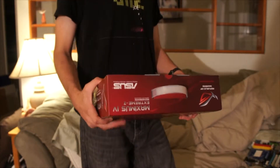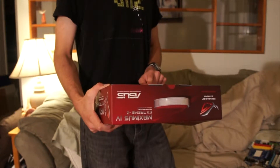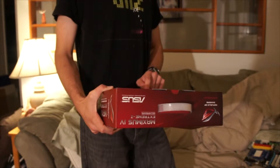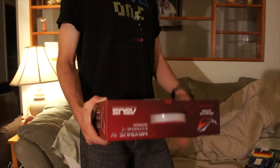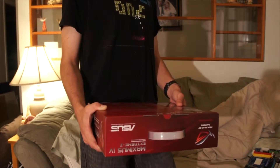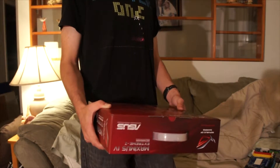Multi GPU storage: Z68 comes with two SATA 6Gbps and four 3Gbps ports. It supports Intel RAID 0, 1, 5, and 10. We also have a Marvell controller, so we have two more SATA 6Gbps, and also external SATA 3Gbps ports at the back through a JMicron 362 controller. The LAN is two Intel Gigabit LAN ports. We also have high definition audio through Realtek, Bluetooth, and USB — a whopping eight USB 3.0/2.0 ports on the back, plus one internal header at mid-board. You can do up to nine USB 2.0 ports, and one is the ROG/USB 2.0 port at the back.